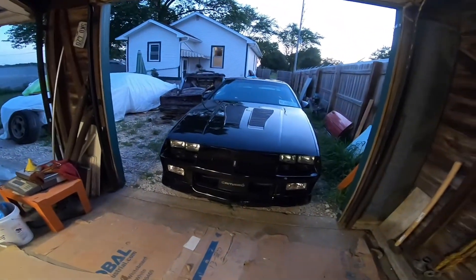Black Magic is having issues — the fan issue is still a problem. I don't know what's going on with it intermittently, even with the Power Master alternator. I thought that was the fix; unfortunately it was not. I started it up today, let it run up to temperature, fans kicked on at 170 like they're supposed to, dropped back to 160. I kept it running to make sure it would kick on again, but the temperature went to 200, almost hit 220, and the fans didn't kick on.